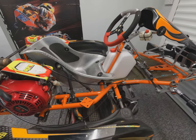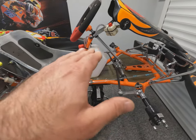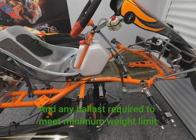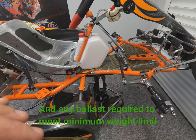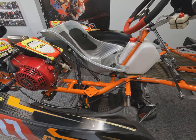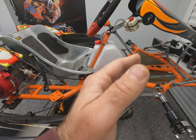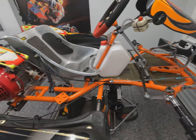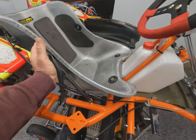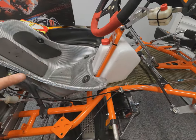For weight distribution, sit the car on four bathroom scales — one on each corner — with all your gear on, sitting in the kart, and somebody takes the measurements. You can then work out the percentage distribution front to rear. On a pro car like this you'd be looking at somewhere between 54–55% rear and 45% front. The main way to move weight forward is the positioning of the driver's seat — you can drill new holes, tilt the seat upwards, and move the driver further forward to put more weight over the front end.